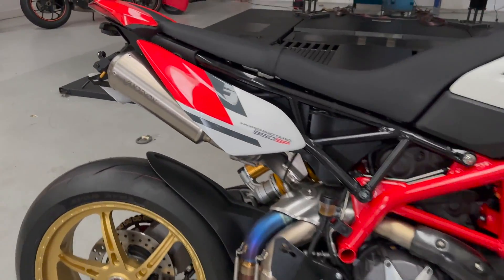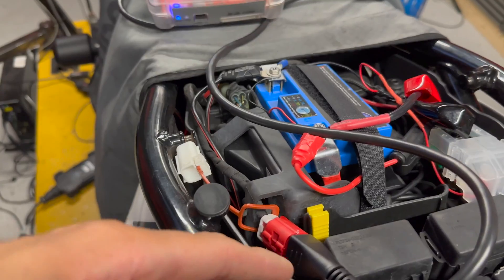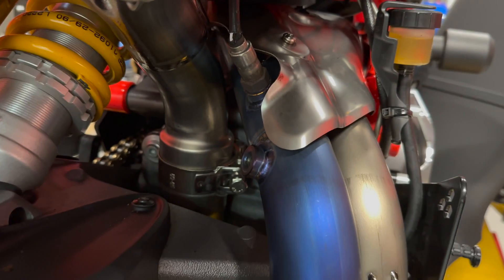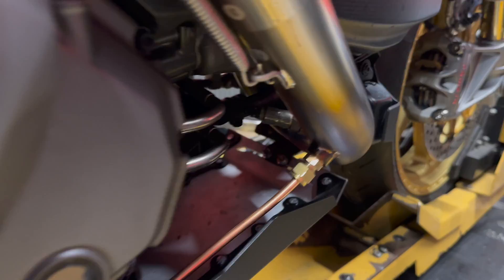Things are moving on — we've got this little portable device, plug it in here, none of that ECU removal stuff, so this should be a lot faster. We're going to try and use the O2 blanking plug — the extra one that comes in the Ti system — to get some extra readings and data. First one is in; this is the rear cylinder. We'll get some data out of that, then do the front one in a minute.